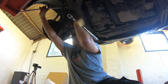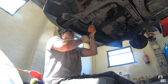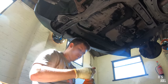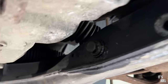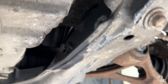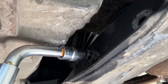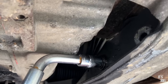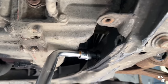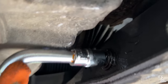This consisted of an 18mm at the bottom but 21mm at the top bolt that came out from underneath, and then two 17mm bolts at the back holding it in place, although this also wasn't without its problems. Because of where this 17mm is, it's a very difficult place to get to. I've just finally managed to find a breaker bar that just about gets in there and with some leverage... Yes! I'm finally getting this to spin.